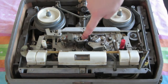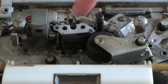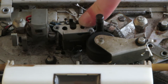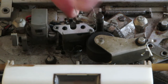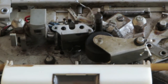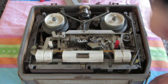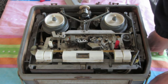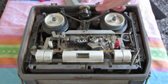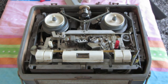Look at that. Right here, if I can zoom in a little - right here there should be a recording and a read head. It's not there. And these are the loose connections right here, so that explains the hum. That's a pity - one of the most important, irreplaceable components is missing. Seems the motor had a little bit of trouble turning there, now it's starting to get loose. Maybe that was the issue. There's a little propeller there.